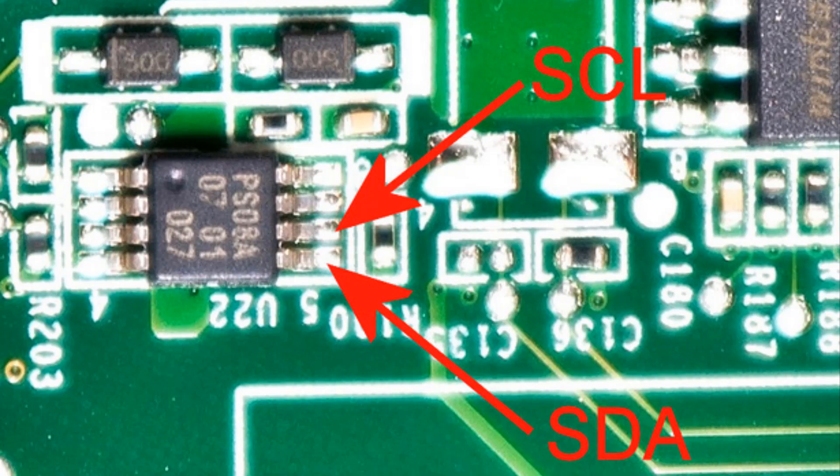Have the keyboard and optionally the LCD plugged into the system board in such a way that none touch any contacts on the system board. Use paper as an insulator to keep things from electrically shorting out. Later you will need to plug in the AC adapter and switch on the ThinkPad.